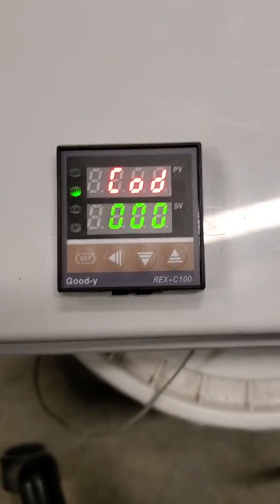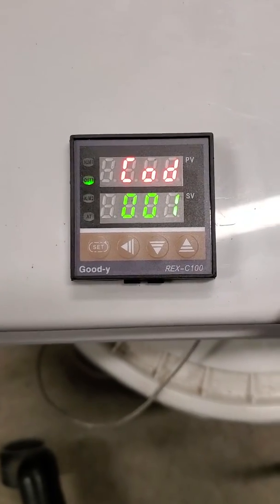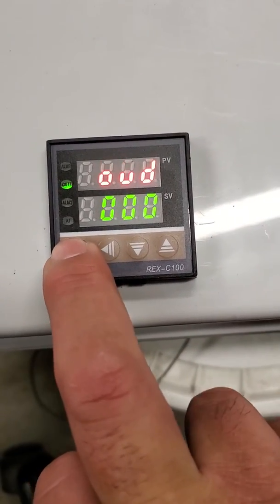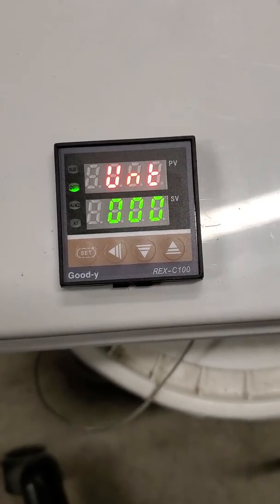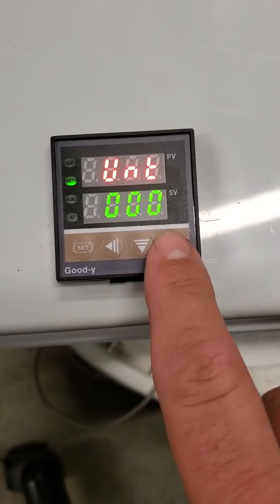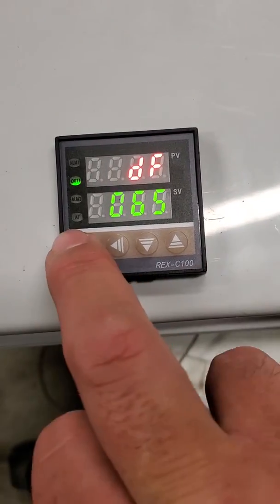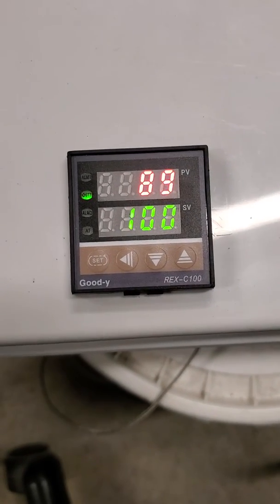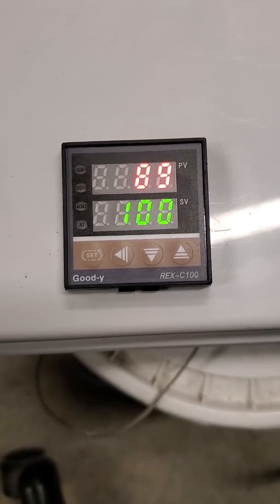together to bring up the card menu. Now 0-0-1 brings up the secondary menu. Hit Set, hit Set again, and scroll down until you see Units. Once you see Units: 0-0-0 is the code for Celsius, 0-0-1 is the code for Fahrenheit. Hit Set, hold Set again — bam, we're in Fahrenheit. It's just that easy.